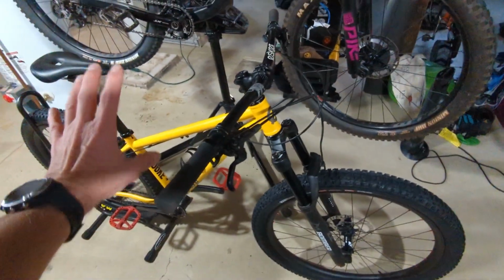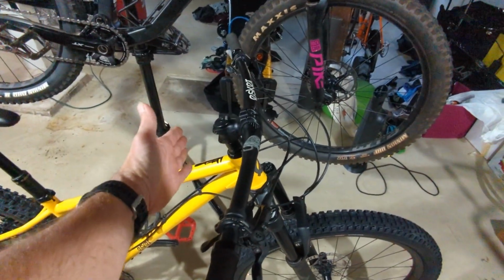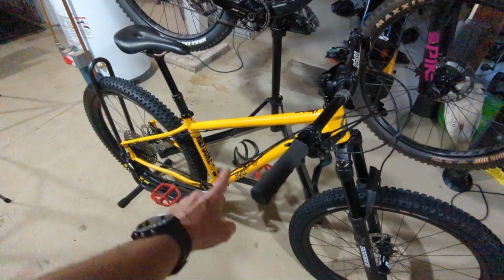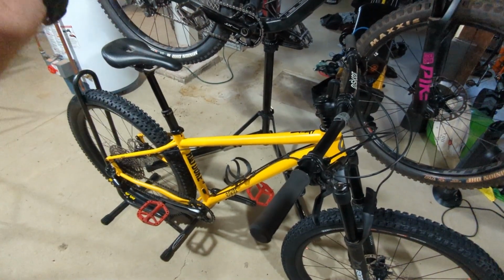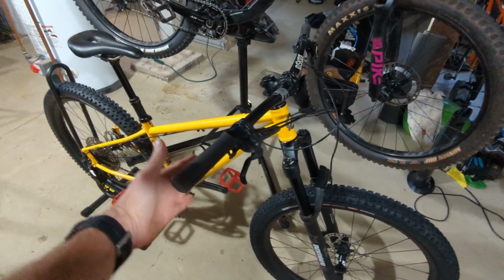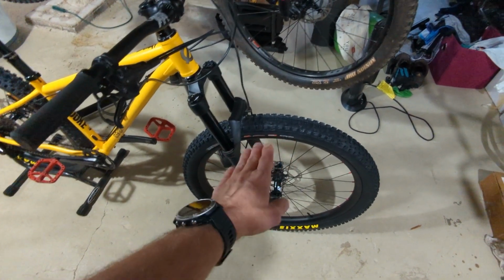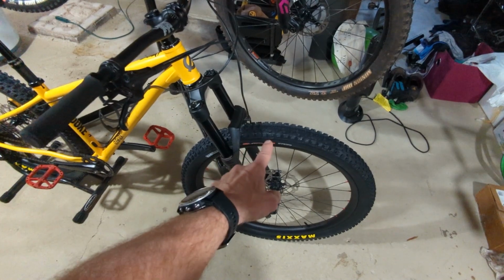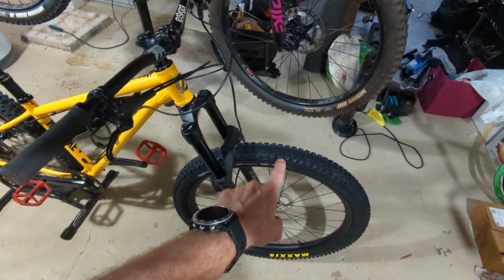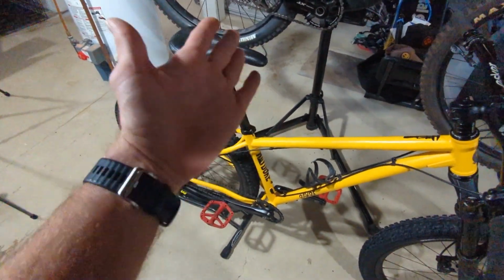If you look at how a body is positioned, and given that you have everything else set up correctly on your bike and you're not running some old school thing with a short frame and a super long stem and all of that, which I will talk about in another video, your body weight is, when you're seated, you're going to have most of your weight on the rear tire, and when you're standing, you're going to be more centered, but you'll be putting more pressure on the rear than you will on the front. And you actually want the front, and believe it or not, the suspension fork actually matters too, to have more traction. And so having a few less PSI on the front than the rear gives you just a tiny bit more traction on the front. So your bike is just a bit more controlled in the corners.